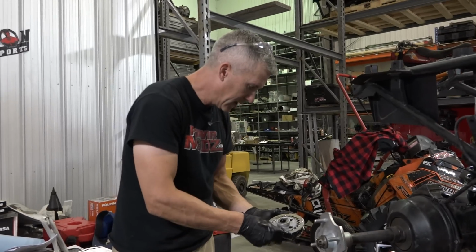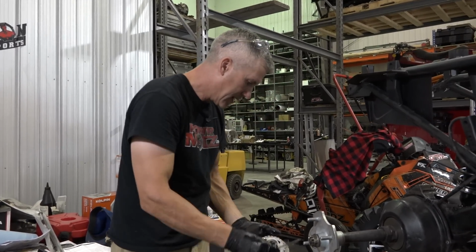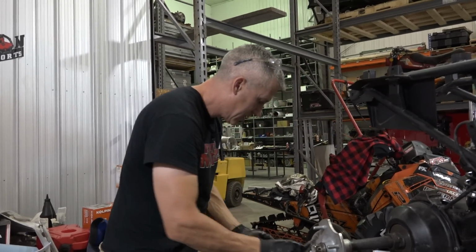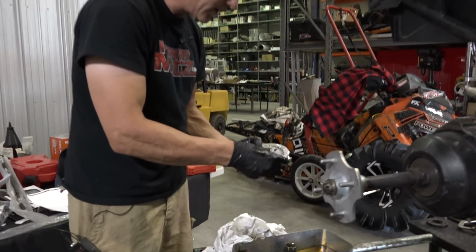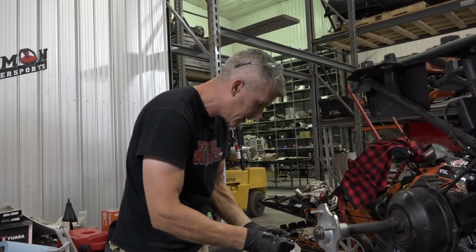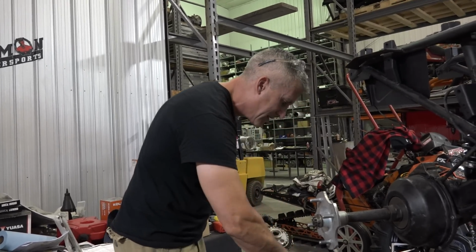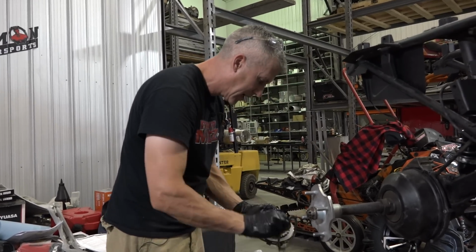Some people say to pre-lube these, other people say no, it doesn't need to, it's a myth. Anyway, we did. In any event, we're still gonna have to lube them up, so we just dumped them in a basket of motor oil that we're gonna use. These new clutch plates are available from us here at Power Mods, of course. I just figured it'd be good to replace all these, especially since we're dealing with a bike with a pretty old clutch and setup in it.